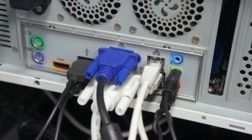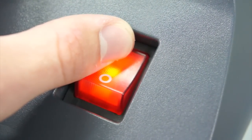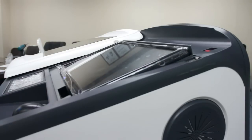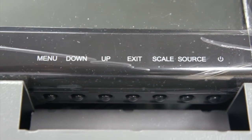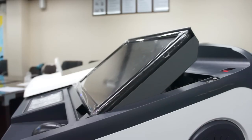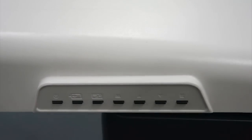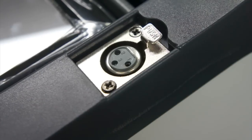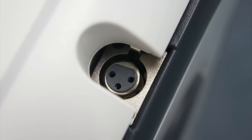After completely connecting the computer, it's safe to connect the ELF to an external power source. Turn on the ELF's main switch and power distributor switch. You can now adjust the tablet monitor's angle — pushing the switch up will cause the monitor to rise, stopping itself at its maximum height. The tablet monitor's power and control buttons can be found at its bottom right. Pushing the elevation switch down will lower the monitor, stopping itself at the bottom. The controls for the sub-display can be found on the bottom of the slide-out panel. The gooseneck microphone can be connected to the audio jack at the top right of the podium, and can be left on as the sliding monitor panel has a notch to accommodate the microphone when closed.